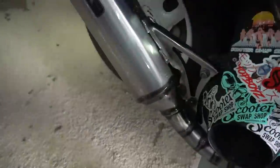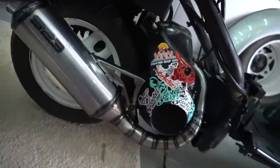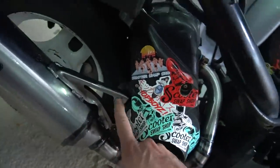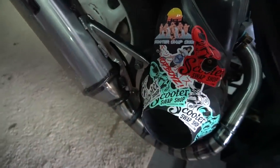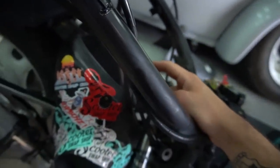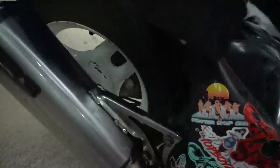Sheesh! All right, new pipe's on there. Little S23 piece, just a V8 pipe. But of course, just like every pipe, I swear, I have to drill out these holes a bunch, because once you put the gasket in, it spaces it forward and then these holes don't line up anymore. They're way too far forward. I think when they mock these up, they don't use a gasket, and that's probably why. Just that little bit makes a big difference. But basically, drill it out.